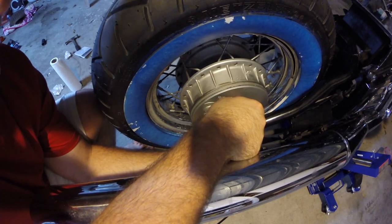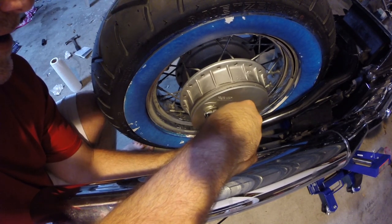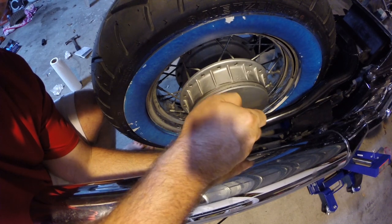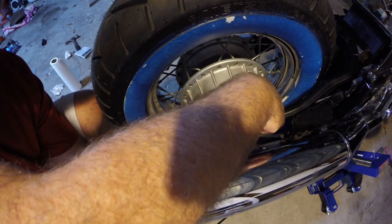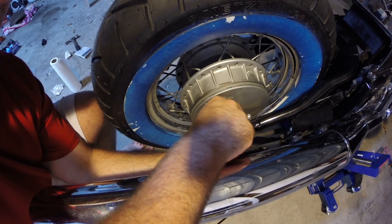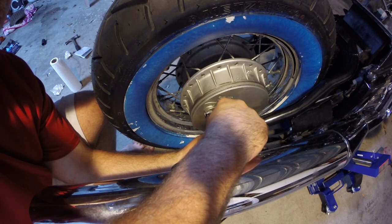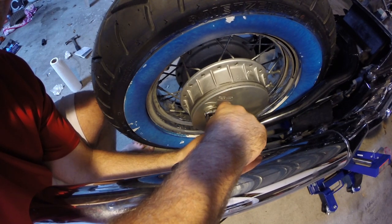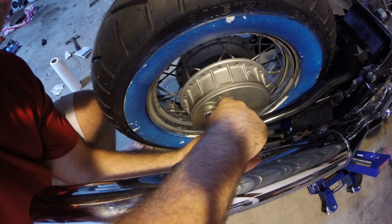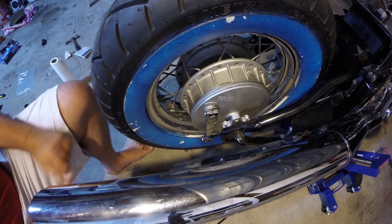I don't have that long fingers. So that means I gotta redo it. And why is this? It's not quite the right diameter. Or the right length. One of the two. Anyway, there's a bit of a gap. I guess it's alright, as long as it's even. Not super important, I suppose. Would be nice if it was actually exact to that spacer diameter. Let me just start these by hand. Because of that gap, they kind of want to go in cockeyed a little bit. So when you have a gap like this, it's important that you don't run one down more than the other. You want that gap on both sides. So I'm just going to keep this hand tight and loose. Obviously, it's got to move around a bit when I put the fender support on.